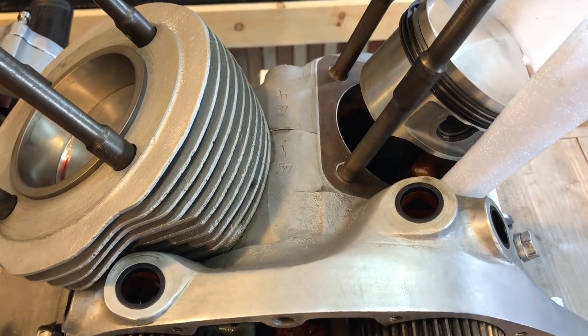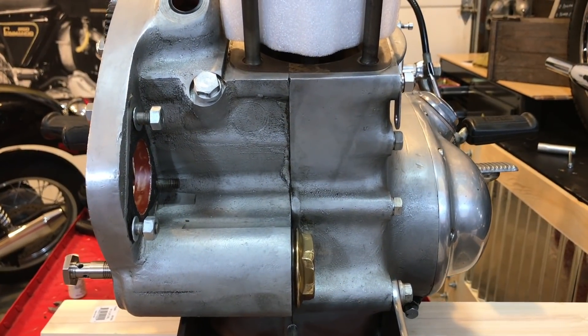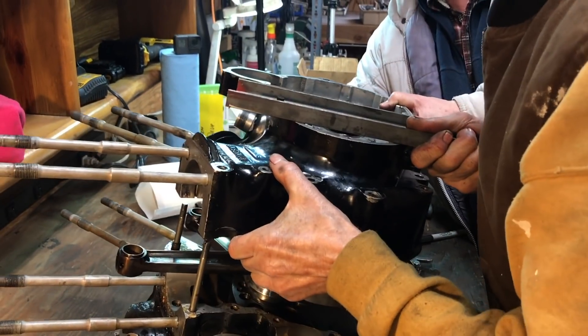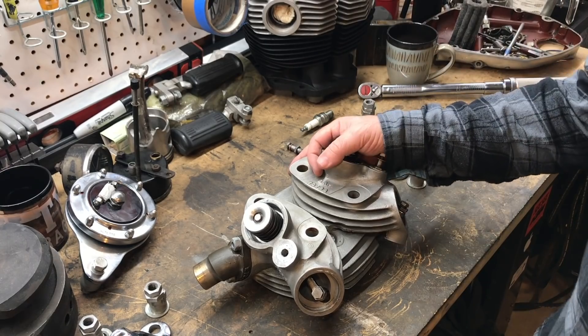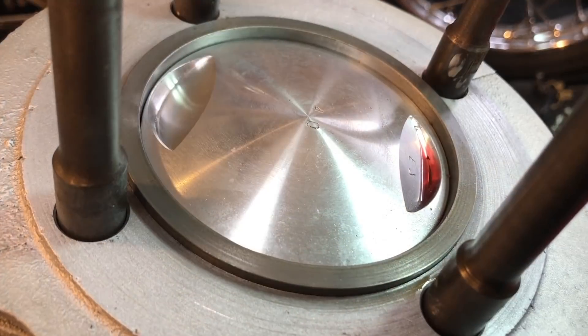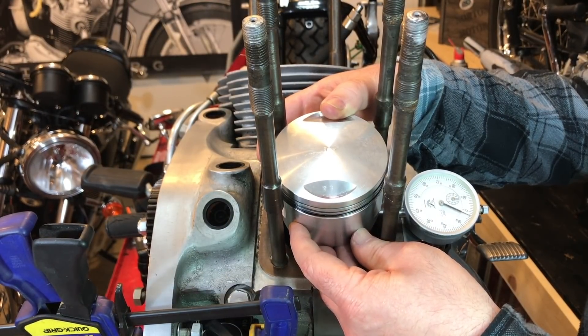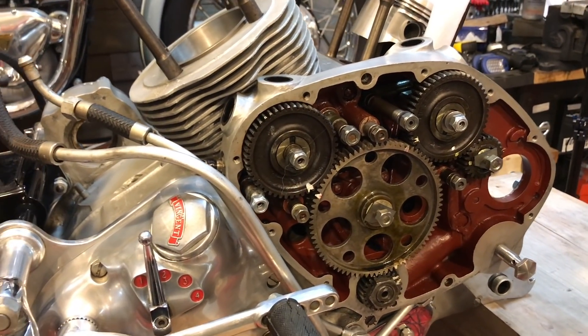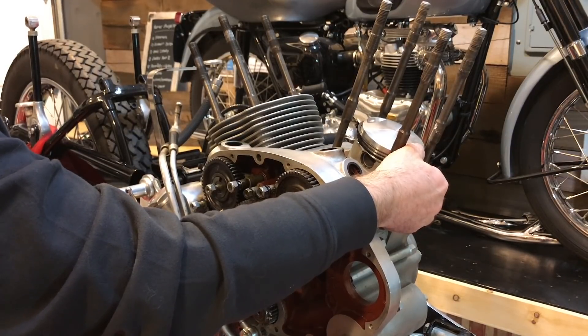I've made an executive decision. I'm not going to remove the rear barrel, and I've decided I'm not going to split the crankcases at this moment in time. If you saw that Black Shadow disassemble video, there's quite a bit of work involved and I just don't think I'm there yet. I'm going to wait and see what the bike runs like before making a decision like that. I'm really happy with how things look. The cylinder heads are great, the valves have been replaced, the 40-over pistons are brand new, the con rods look great, the bores inside the liners have been honed or re-bored and look great, the crank and flywheel assembly looks terrific, and the con rod end play is good — there is some wobbling but it's within tolerance. Everything I've seen is consistent with what I understand happened before I got the bike.